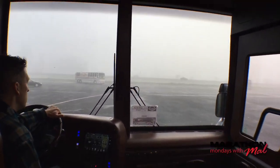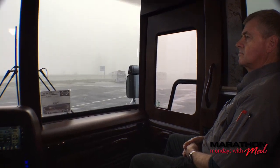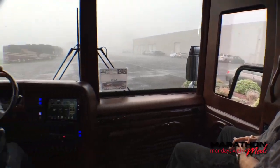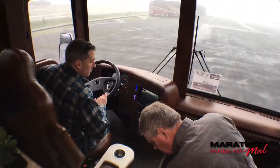All right Dave, let's get into it — let's talk about air brakes. I'm going to pull up here and we'll pump down the brakes. Tell me about the importance of checking air brakes. We test them during our PDI process and audit process to make sure they are functioning properly. If you lose air brakes and the air goes down to a certain pressure, the emergency brake is supposed to kick on automatically — that's what we test. Go to neutral and pull the parking brake up.